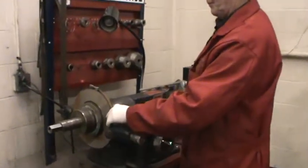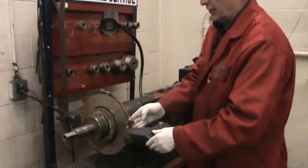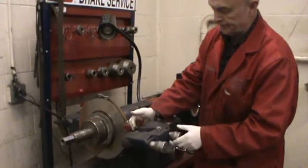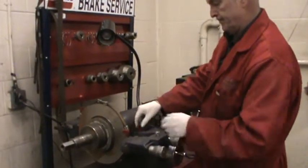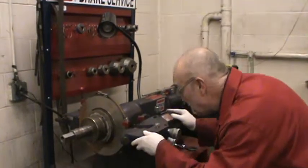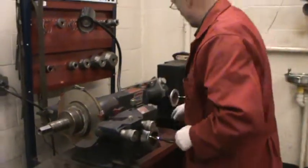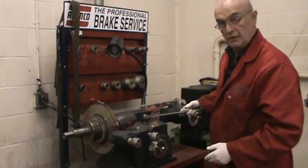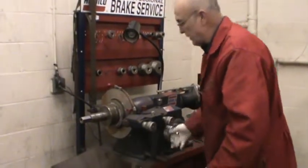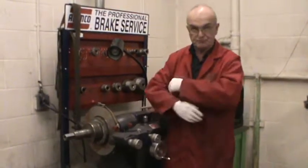Move it down a little bit. Then we're going to move the teeth — not all the way back, far enough that they clear the rotor. The moving back is counter-clockwise. We're going to center it exactly as your eye can make it in the middle of the rotor, and tighten the nut. To check that we have clearance, we can see that we can move the twin facing tool in and out without touching the rotor. It is now ready for machining. Thank you very much.